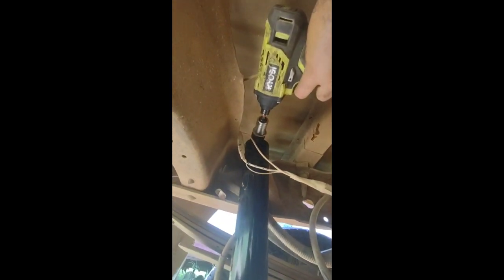I'm back — I got it on there. It wanted to fight me the whole way to the bitter end. What I ended up doing is getting my grease gun and putting a slab of grease on the place where it mounts onto the mounting stud, then put a little bit inside of the shock ear — that part right there — and it went on just fine.